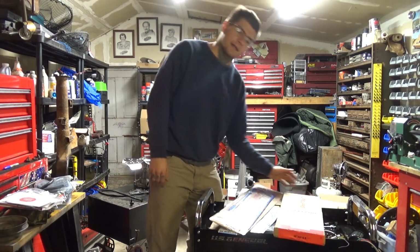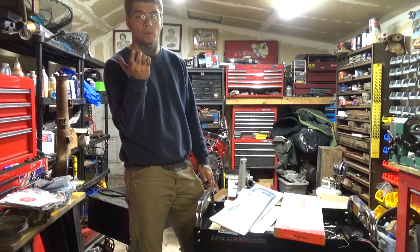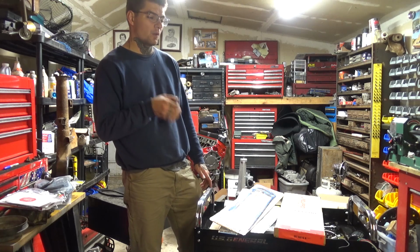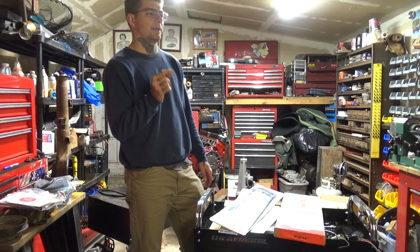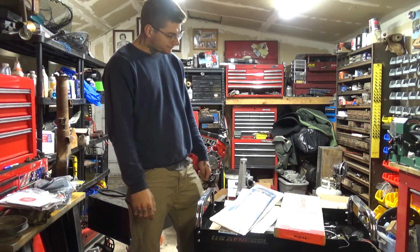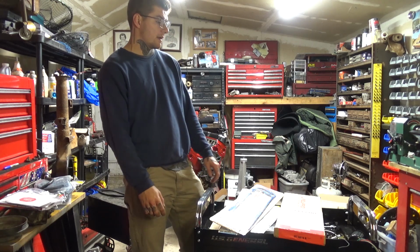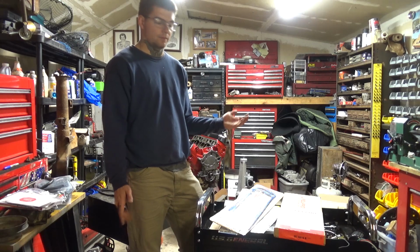The oil pan that I had, the oil drain, I don't remember if I put this in the video, but somebody welded the oil plug completely shut and then put a smaller bolt inside it, and then they stripped the head off on that. So I tried to fix it, didn't work. The oil pan leaked when I was testing it with water, and I'm just going to buy an aluminum aftermarket or just a stock aftermarket, whatever one I need.